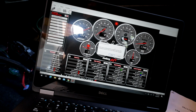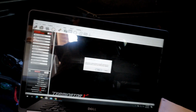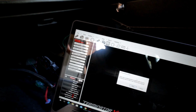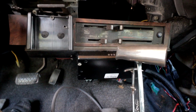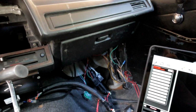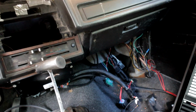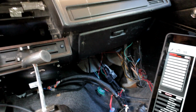hand. So now as long as I can get the wheels off of the car, then I can put it on the dyno and see what's going to happen. I don't know why it keeps dropping the signal, and it has just a standard Terminator X ECU, but I think it's a 4L80, and has some sort of other computer in here to control that. So I'm really hoping that I don't have to get involved in that, and hopefully we can just calibrate the engine.